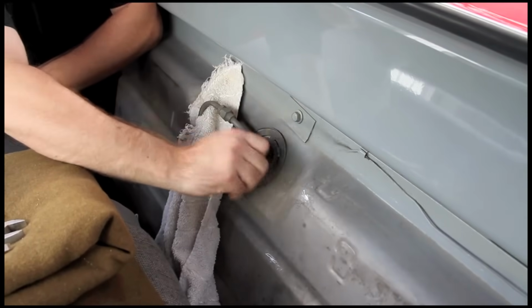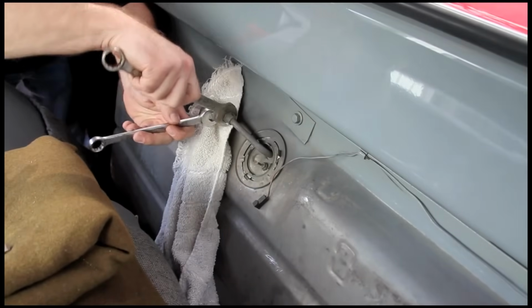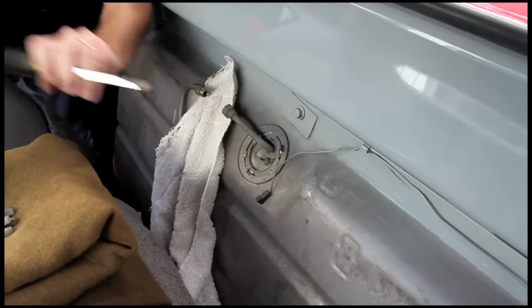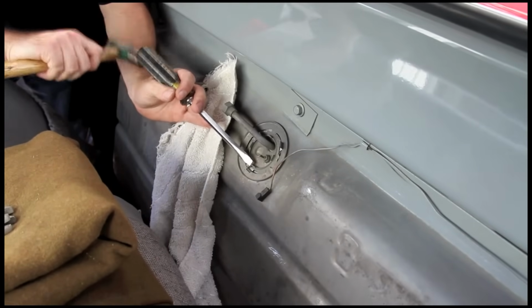The first step in getting your fuel level gauge working is to determine the resistance range of your sending unit. We need to know what the sender reads at full and at empty to select the proper gauge. Because our Chevy has the sender right behind the seats, we decided the easiest way to do this was to simply remove it and perform a bench test.